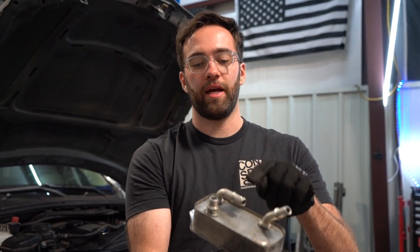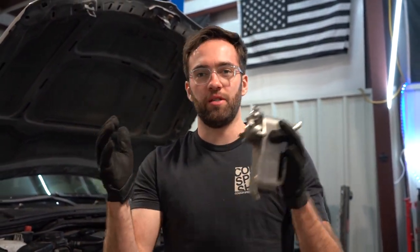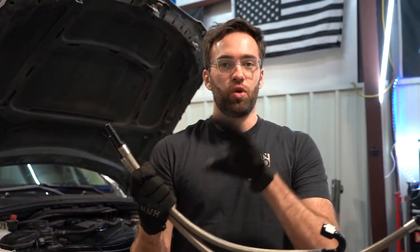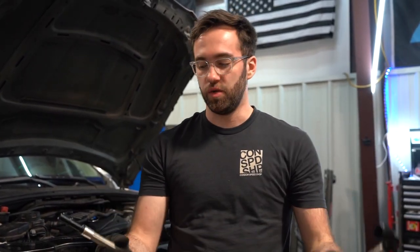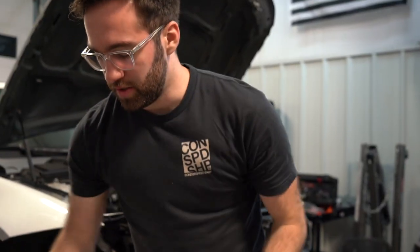The transmission fluid runs through these lines and back out, and the coolant runs through this one and also this one as well. The stock one actually bolts underneath to a fan and gets sandwiched between the pulleys and the fan — there isn't much clearance there. A good upgrade from that is this beautiful kit that Berger Motorsports makes, linked in the description. It replaces the coolant-cooled fluid with air-cooled, using a big cooler that sits in the wheel well.